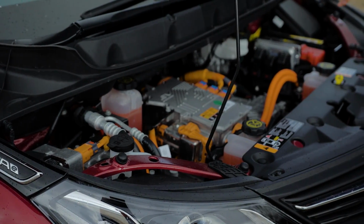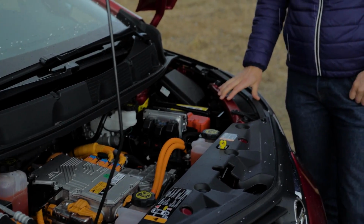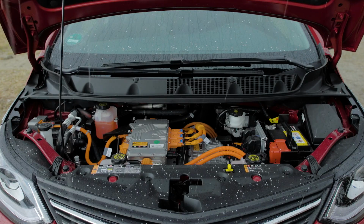And again, the battery, you can't see it right now. You could just see the engine parts, electric engine parts and so on. The battery that is placed in the bottom can have 60 kilowatt hours of power capacity, and most of the competitors are below 40 kilowatt hours, and that will give an official range of 520 kilometers in this European cycle, but it's not really realistic. If you deduct 1/3 of it, you'll end up with 350 kilometers, and that's really comparable to Tesla and above the realistic figures of, for example, the BMW i3 or the e-Golf.